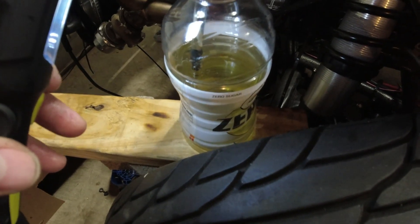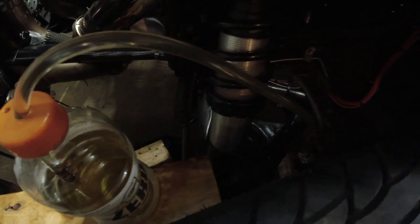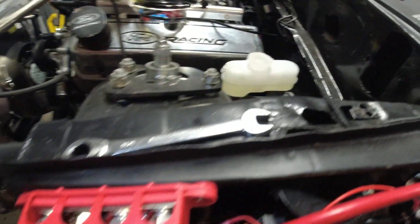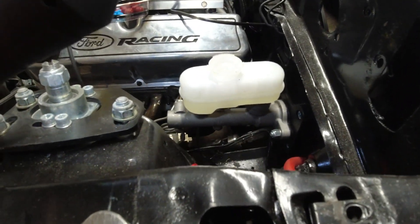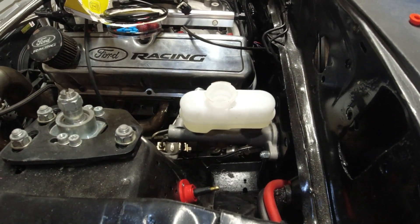Now I'll run into my little bottle here. Before you pull that little hose off, tighten down the bleeder screw, then you can take your line off. Be sure to pinch the line when you pull it off because you don't want brake fluid everywhere — brake fluid will strip paint, so just a heads up. Easy paint stripper right there. The reservoir went down to the low mark, so I'm just gonna top it off to the max and call it done for now until we're able to do a little test drive.